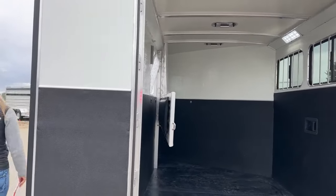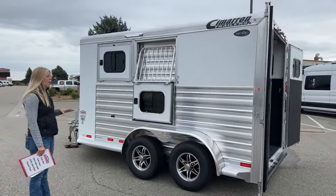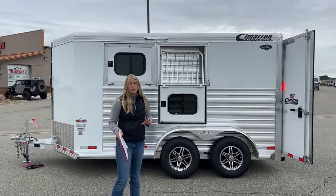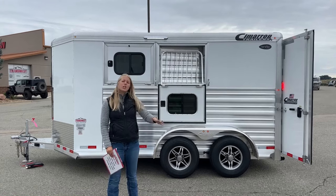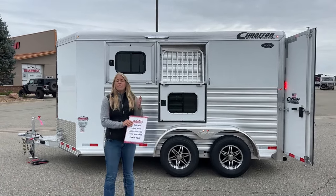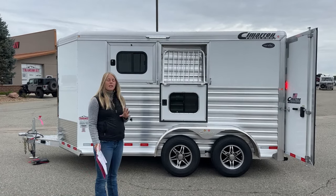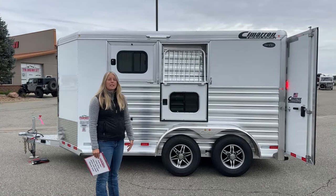As we work our way around here, this trailer is running on two 3,500-pound rubber torsion axles — plenty of axle underneath this trailer for a two-horse. As you step up in size, Cimarron actually uses engineers to determine what size axle, wheel, and tire they need underneath their trailers to make sure it is properly loaded. Too much axle underneath the trailer and it's going to be bouncy, stiff, and a rough ride for those horses if you're not running fully loaded. Too light of an axle is obviously another problem. Cimarron takes it a step above — they have engineers that design these trailers, which means they're going to be a really well-balanced, good-pulling trailer, and also able to withstand what you throw at it.